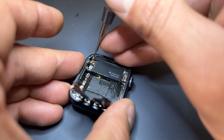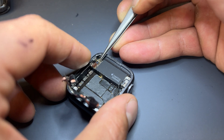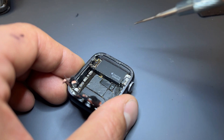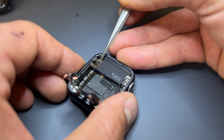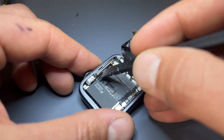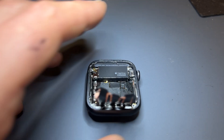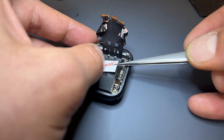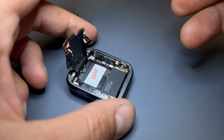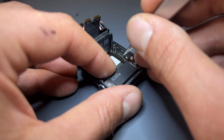The top left screw is that little brass one. The bottom left of the taptic engine needs the shield on it first — make sure that goes on there, otherwise you run the risk of the antenna cable disconnecting whenever the device is dropped. For the battery, I'm using a 10mm sheet of Tesafilm tape since battery adhesives aren't readily available for Apple Watches. Remember with the battery that you need to connect it to the board and screw it into place before sticking the battery down fully.